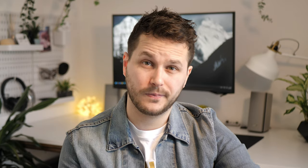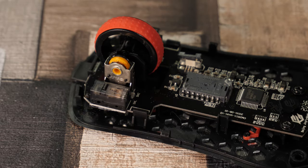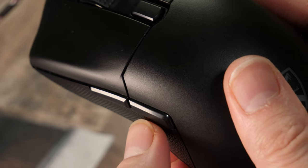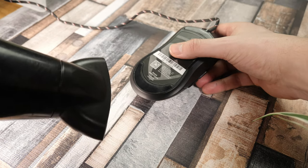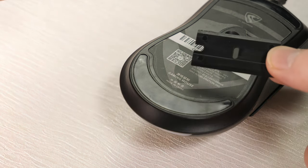So how does this shiny little miracle work? First, you need to diagnose your issue. The most common complaint that aluminium tape can fix is pre-travel — how far you have to push a mouse button down before it actuates and the click is registered. A button with a lot of pre-travel can feel loose or almost shaky and rattly to touch. To apply this fix you will need to open up the mouse, which might mean a new set of skates if you're not careful taking the stock ones off. I recommend applying a bit of heat with a hairdryer for a few seconds to loosen up the adhesive before you peel, for the best chance of getting them off without bending, breaking, or scratching. I use a plastic razor blade or thin spreader to remove the feet from the base of the shell without scratching the paintwork or the skates.